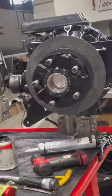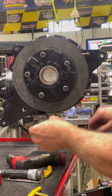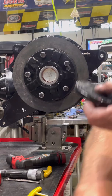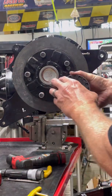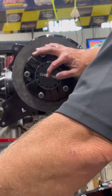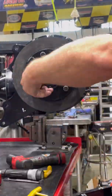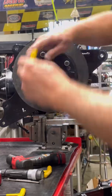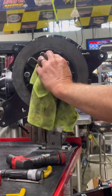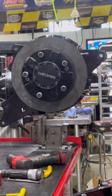Now all we have left to do is put a cap on the end of this. We put a little silicone on it and it has about eight or ten 10-24 allen bolts that hold it on. Once we get that on, that finishes up the assembly on the spindle part of this rear end. In my next video I'm going to show you how the lug drive system works on the wheel, we're going to mount some calipers, and we're going to shove this thing back into the chassis. Please subscribe and like this video — this is in-depth information on top fuel cars that nobody else does.